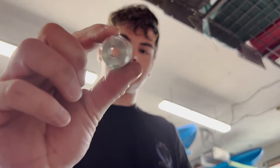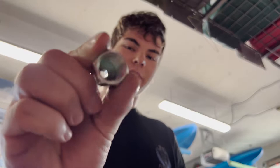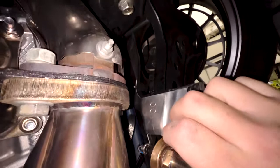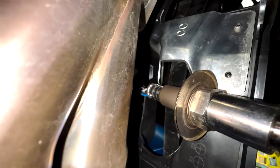With the O2 sensor out — it's actually fairly simple, just grab a 7/8 wrench and give it a little turn. The only thing you're going to fight is this little plate thing right here. This is the defouler from Blocks Racing — I will put a link in the description if it works; if it doesn't, well, we'll find out. It's fairly simple, it's got that little hole in there, that should get the job done. So we're just going to go ahead and screw this on, make sure it's all tight. I'm going to try to screw this into the O2 sensor port first and then plug the O2 sensor into that, because it is not working as a one-unit assembly and I'm not dropping these headers.